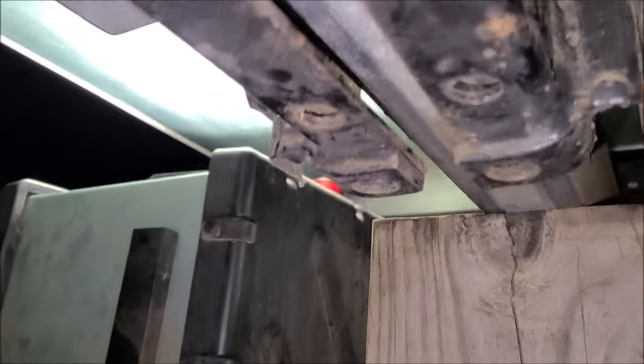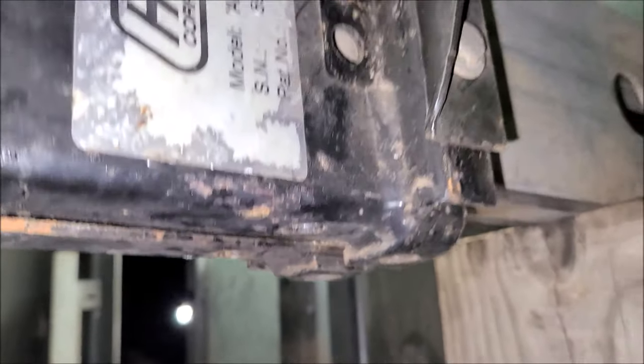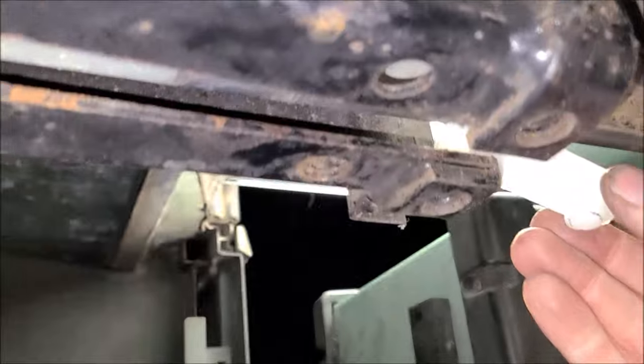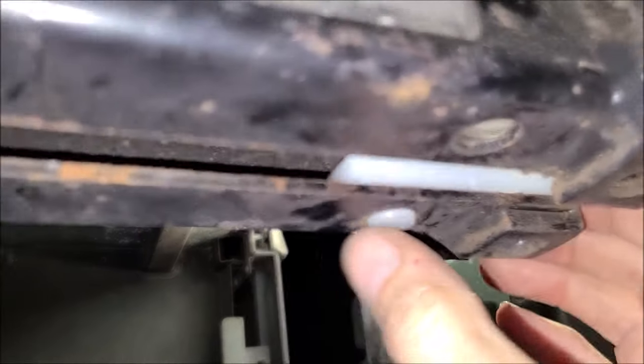What we now have to do is get our shims and get our two bottom bearings in place. I'll lower it, get the top bearings, and I guess this one will be the last. All right, now I figured this is a good idea: just do a dry run, make sure they do line up and they drop down in the holes like they're supposed to. It dropped in there nice, easy peasy. Get it back out.